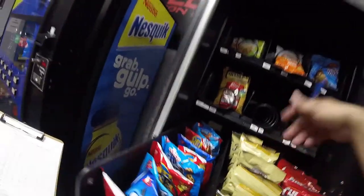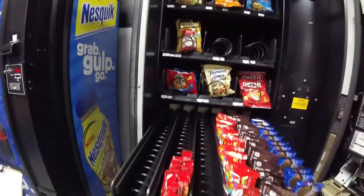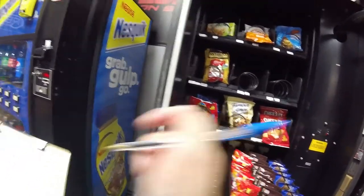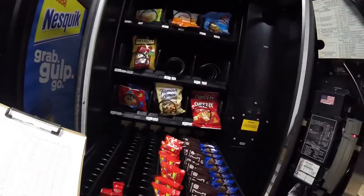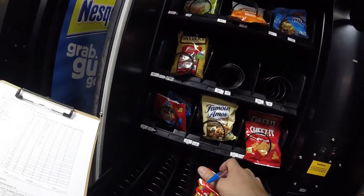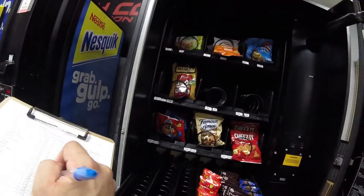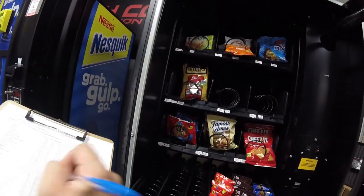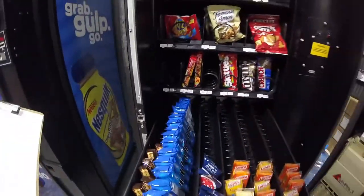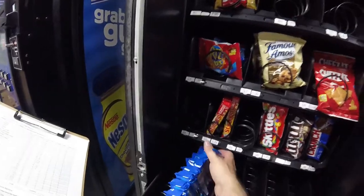When I do the next video I need to set my par levels — that's the amount of items you can have in each row — and I want to set my inventory levels per those par levels too, so I know exactly how much inventory is in each row. I'll need to go back and do a final stock-up after the install. Right now we're getting our inventory numbers, collecting the cash from the cash box, and then installing the IN-ONE board to make this machine credit card compatible.